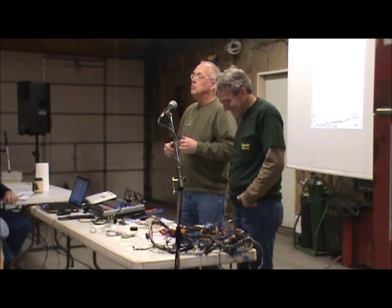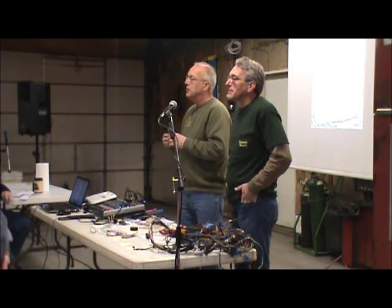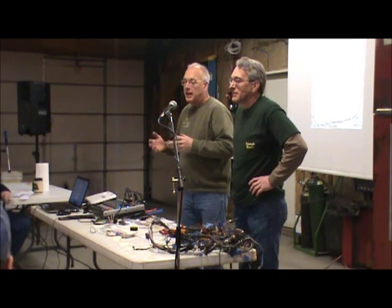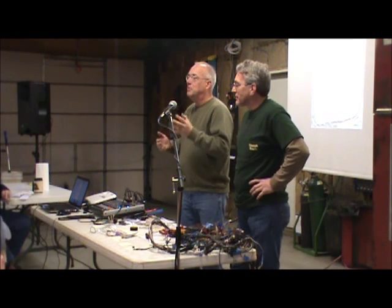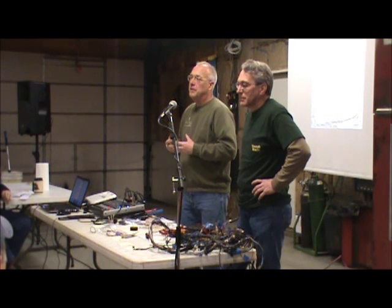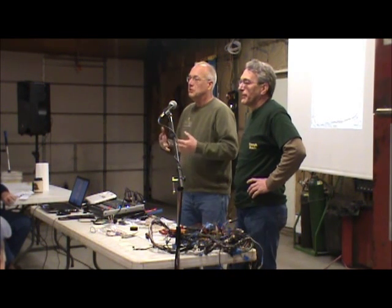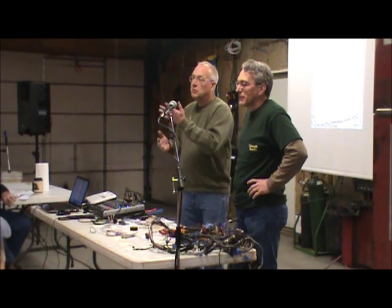But the bottom line is, we do some of what I call kind of crazy conversions, where we're putting a 100 amp alternator in the Triumph. And the car's not going to be very happy with that unless you take some of that amperage off the system, because the system can't handle it. So that's a great question.